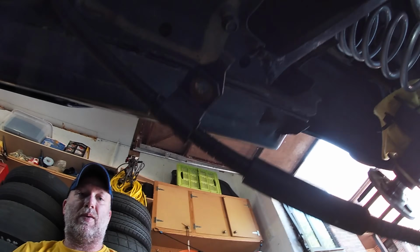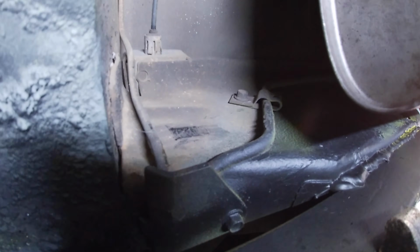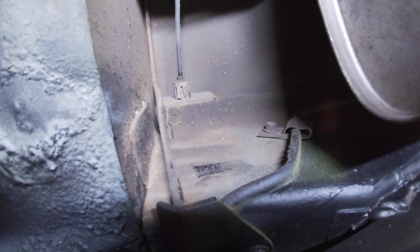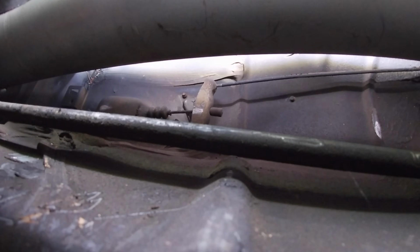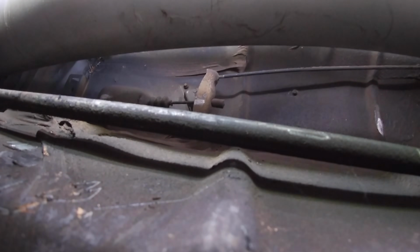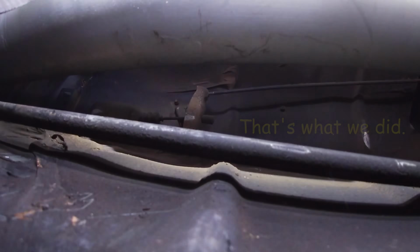Alrighty, we had to take the one clip down for the parking brake cable. If you follow it in, there's another one of these compression sleeve things. We'll need to get the 1/2 inch wrench on, and then follow that back around. Then disconnect things back here at the splitter for the parking brake cables. I think it's almost easier to cut these old cables off rather than worry about slacking things off. We'll get these off next, and get the other cable swapped in.